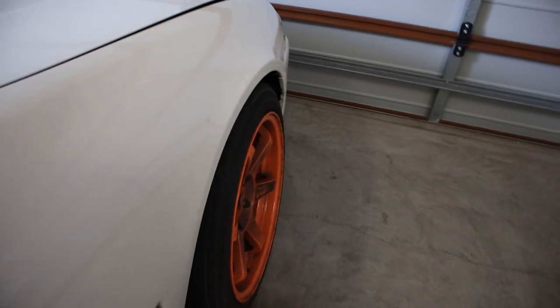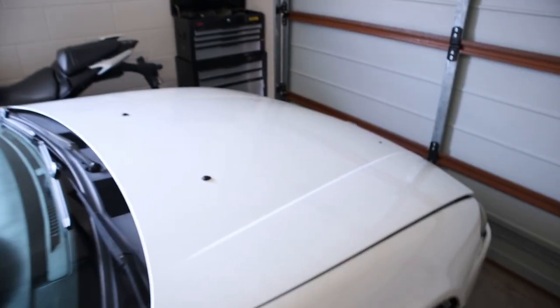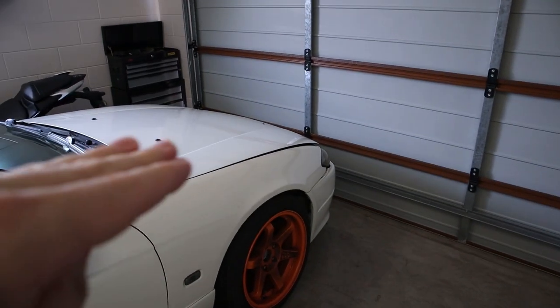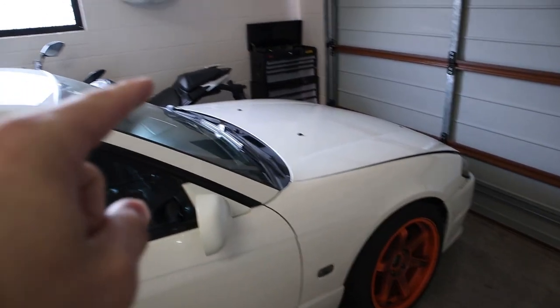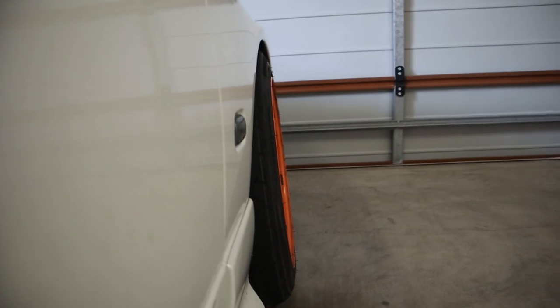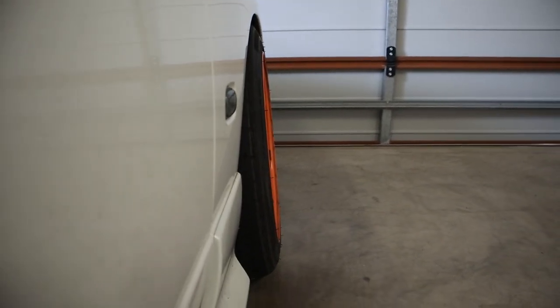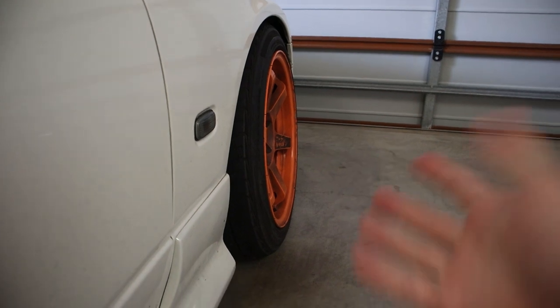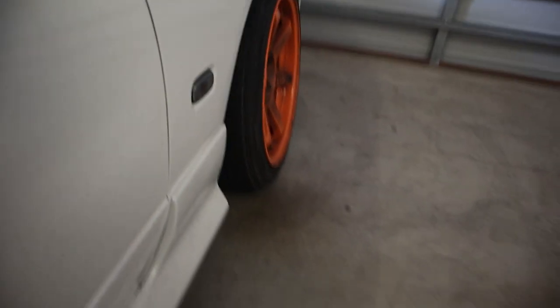And we are having quite a bit of contact, particularly on the other side. I think it's not cambered as much on this side — the camber plates are fully adjusted, the other side is still on the factory setting. So with camber it seems to fit, but I'm still umming and ahhing about whether I go out and buy my own wheels that are this exact size. I've really been struggling, if I'm honest. I'm already sweating and I haven't even started doing anything.